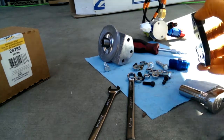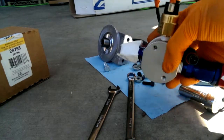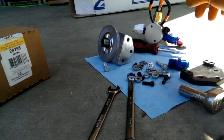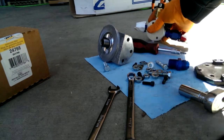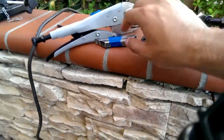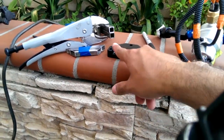I can use this mount. I was trying to put this in the tunnel originally, just attach directly to the AccuSump — it doesn't work. There's not enough clearance for a couple of the pieces — mainly the pressure switch wasn't clearing the tunnel. Just the same way I mounted the oil filter mount, I'm going to put the plate on the other side — the passenger side — and attach that. Mount for my EPC valve that came with the kit — I'm going to be welding these together into a little set of brackets that will attach here and to these holes back there.